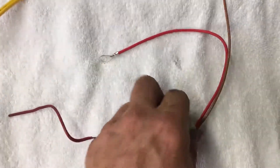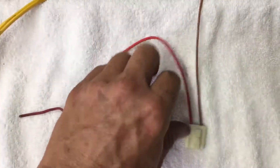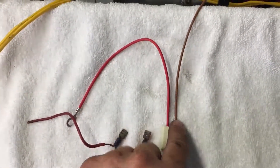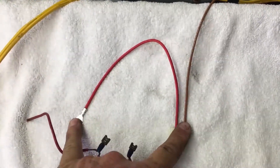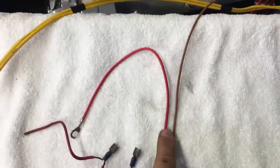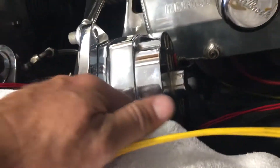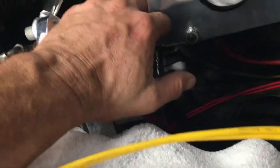The other thing you don't do is go from here to here — making the loop from here to here and jumping it over and calling that a one-wire alternator. That is not a one-wire alternator. You do not go from the battery post to the keyed-on excitation side of the alternator. That will make the field and this alternator run constantly — in the middle of the night, when it's hot, when it's cold.